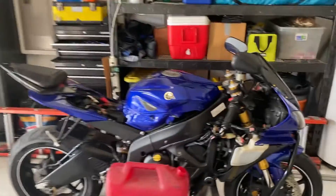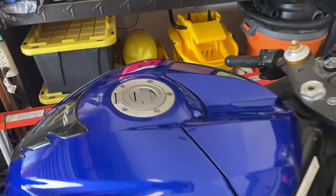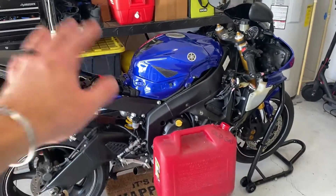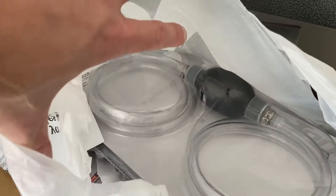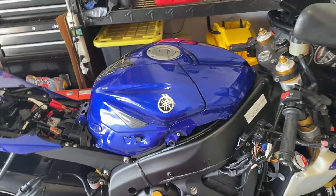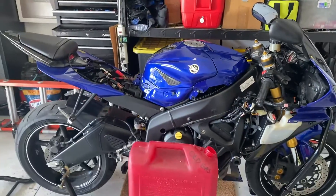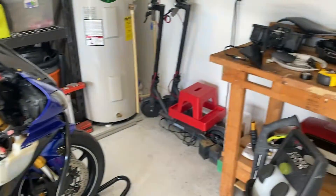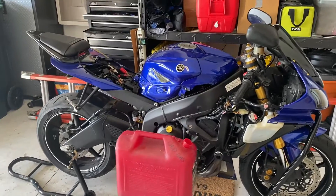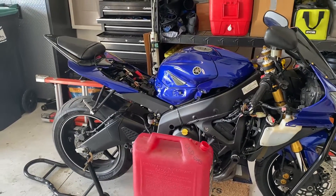It is the next morning, so I am ready to hopefully get this thing running today. The first thing I'd like to do before we run all the tests is drain the existing gas in the gas tank. I was able to purchase a siphon from Advanced Auto Parts, and we will be using this to drain the gas. That's step one because I keep having to lift the tank and it's kind of heavy, and we are not going to be running that old gas through the rest of the bike, especially with the new throttle body and secondary injectors that we've purchased.